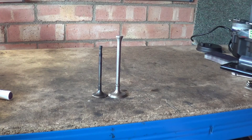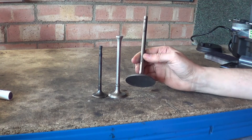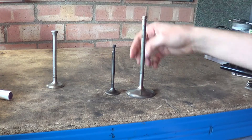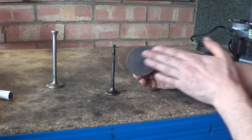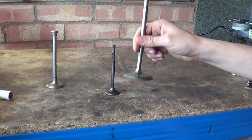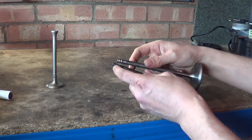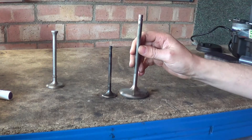The other valve is this big one — it's out of a drag engine. You can plainly see the difference between the two materials on the valve. This is a massive version of the newer valve; it has three cuts, which you can plainly see. It has a flat bottom due to the combustion chamber arrangement — no dimple needed. The stem-to-head ratio is quite hefty. It also has a secondary ring for a clip, plus the same collet arrangement, but with a different relief and a clamping area where the collet makes contact and locks in for stability.